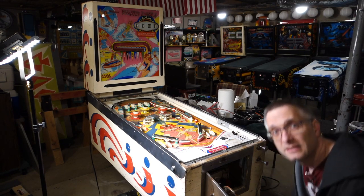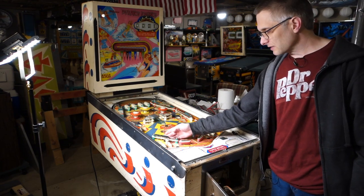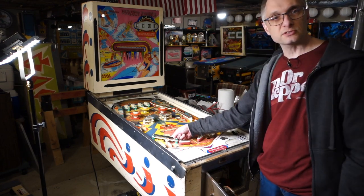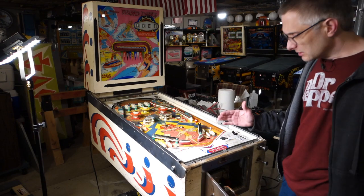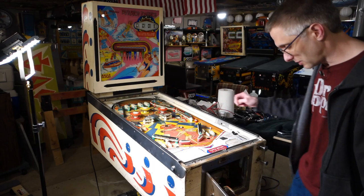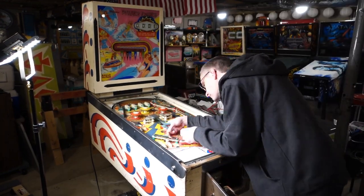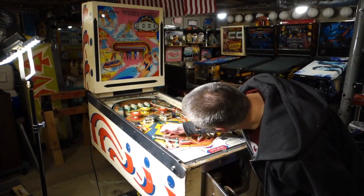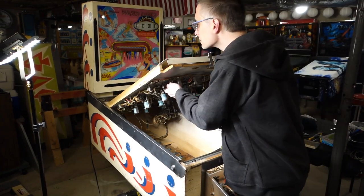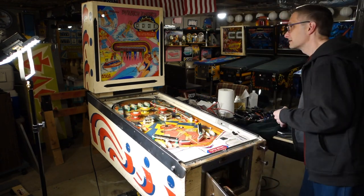Okay. It did start a game. But this switch over here is real sensitive on the 10 points over here. Which is understandable, because I did pull all the switches apart. So, started shotgunning there on the slingshot. So we'll adjust that switch and we'll give it another try. Excellent, I'm very happy with how that worked.